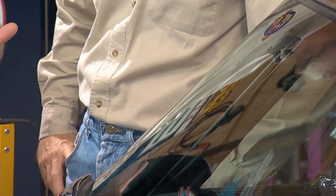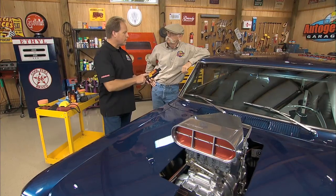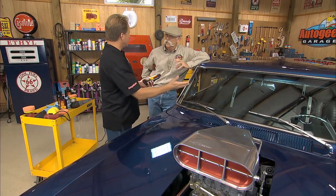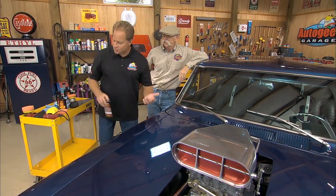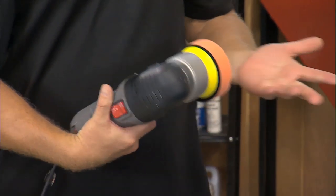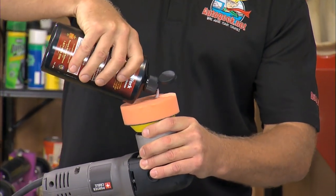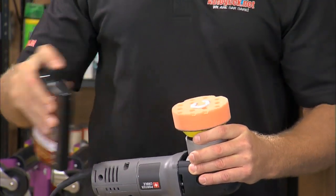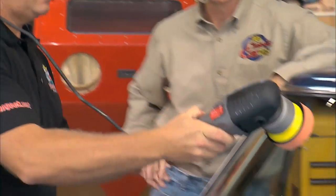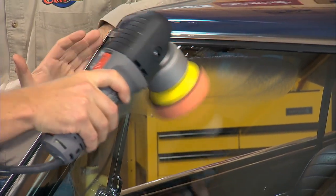What you need is a glass-safe abrasive. What I have here is the Glassworks Water Spot Remover by Pinnacle. What's cool about this is it's not going to put scratches in the glass, and you can apply it by hand or machine. You're kind of a machine guy though. I like to play by machine. I've got a rotary buffer here, but I also have a Porter Cable — these are so popular and so easy to use. I'll just show how to use this. All you want to do is put a little bit of this onto your pad, then — so I don't scratch the paint on all this horsepower — put the pad down first, turn it on, and then just rub this back and forth.